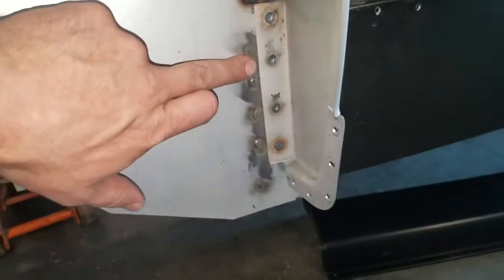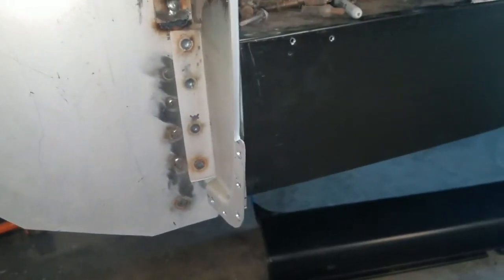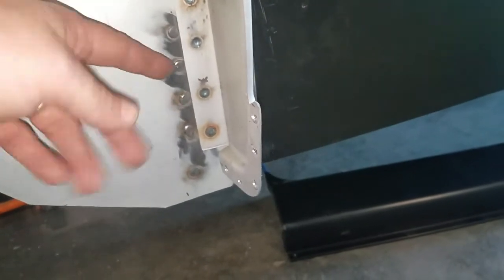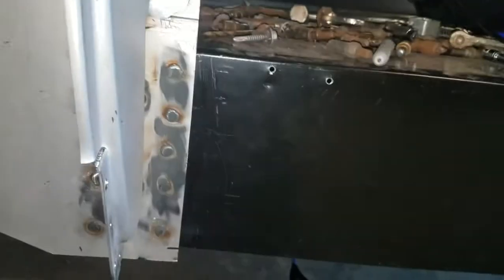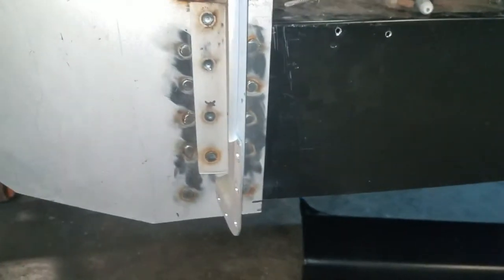We talked about it, but to show you, these welds here are all into the floor pan assembly. This here is just spot welds on top. I had to sort of spot weld those first. You see, it's got a row. I just put two rows in it to attach this to the cowl panel, the kick panel.